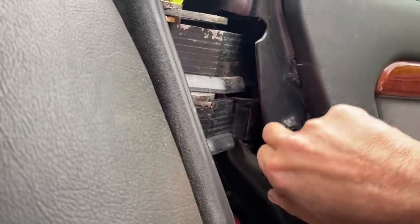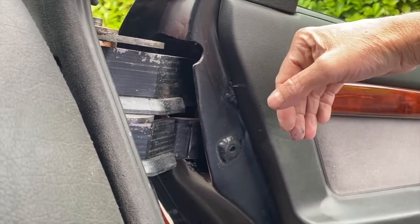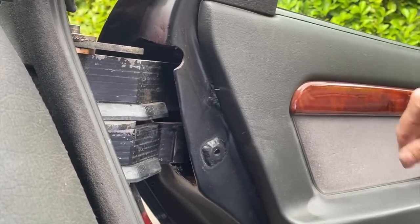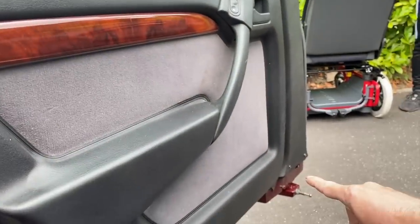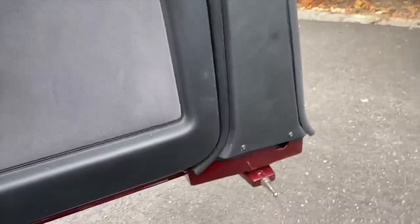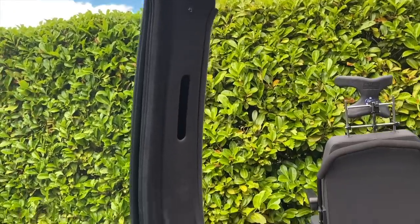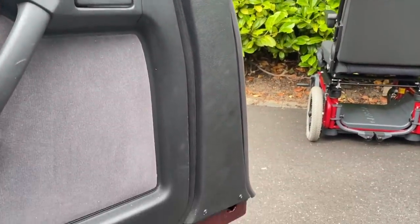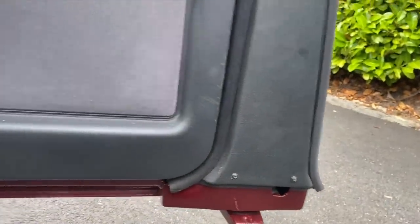Down where the original latch would be, I'd expect the reinforcement goes quite further into the door — you can see a couple of bits of welding further in to stop the door dropping and to spread the load, because the distance between this pivot point and that pivot point is massive. Any movement here is going to be pretty accentuated over in this area. The B post has been box-sectioned and welded to the door, so when you close the door it still looks like the B post is still in place.